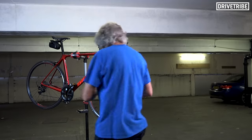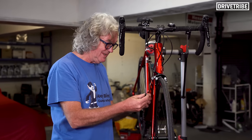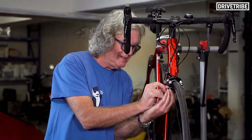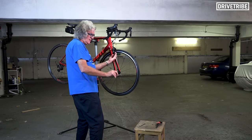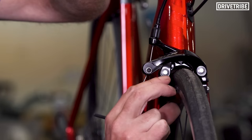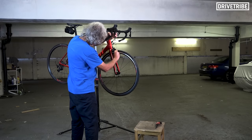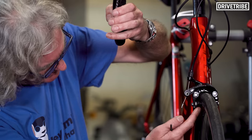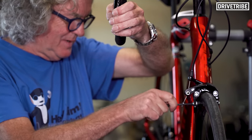Let's put that back on, being absolutely sure to put the brake blocks in the right way — otherwise the first time you brake they will simply fly out and you will be killed. Now the first thing to do is make sure that your bicycle brakes are properly centered and that your brake blocks are contacting the correct bit of the rim. It mustn't go over the top where it will go into the tire and eventually cause a puncture, and it mustn't go underneath the braking surface otherwise you'll wear a ridge in it and eventually start wearing away that bit of the wheel.